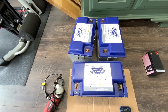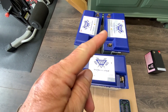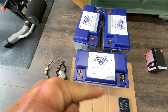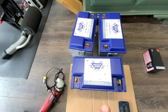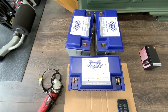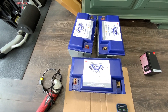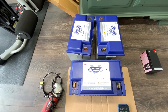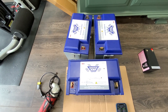Basically, if you have a golf cart you're better off buying a 51-volt battery with a 200-amp BMS — that way you'd have no issues. Another problem with four individual batteries is that if they're not all topped off at the same charge, the voltage can drift apart over time. You might have one battery at full voltage and another at 95%, and that just gets worse. If you're doing a golf cart replacement, I'd just buy one battery with a 200-amp BMS.